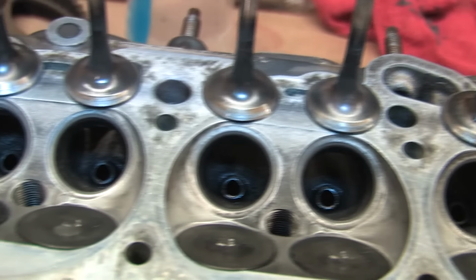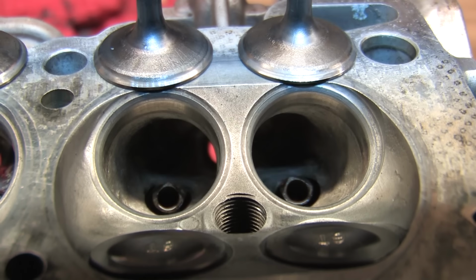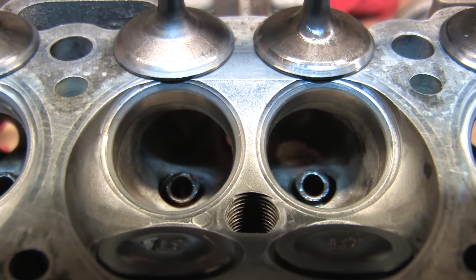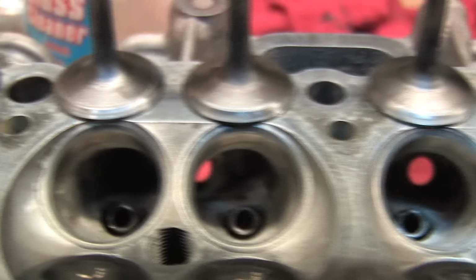I don't even have to replace anything. The whole job took 3 hours up to this point. I still need to clean the lifters and rockers, and to get the head stud holes drilled larger to fit on a 6-bolt short block, but aside from those tasks, I could reassemble this head and put it back in service.